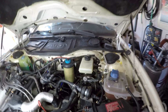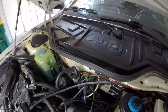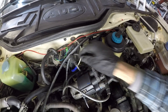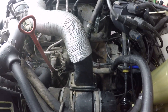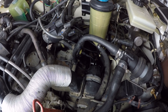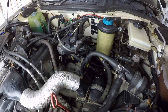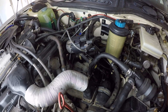As part of my HVAC diagnosis, I found a few very old vacuum lines here in the engine bay that operate the heater control valve, so I've replaced all those with silicone vacuum hose. But in doing this I found out that the heater control valve — located down in here — leaks. After I've done the entire cooling system, I find a point where it's leaking. The reason I didn't see it before is because the vacuum line going to it wasn't pulling a vacuum due to the situation with the HVAC box under the dashboard. Long story short, I've ordered a new heater control valve and will get that installed once it arrives. It's not a major coolant leak, but it is a leak all the same.